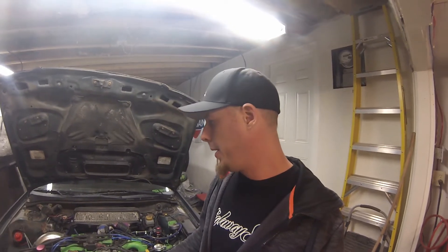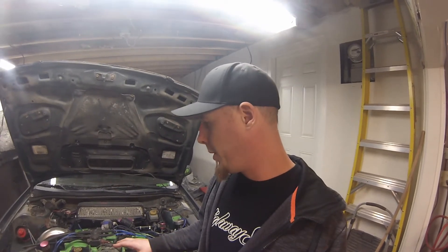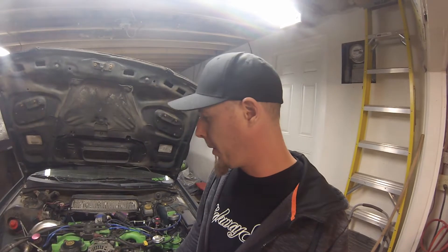I really haven't driven it at all. The car sat out on the road, and I actually had to boost the battery to get it in here. Now that I've got the car inside, I'm going to go about doing a compression test to start with. I'm not so sure it's going to actually show me anything wrong with the car, but it always might. And at least if it points at a cylinder for me, then I might go ahead and just do a leak down test to see how much blow-by there may be, if it's a cracked piston or something like that.